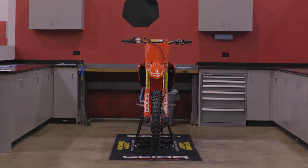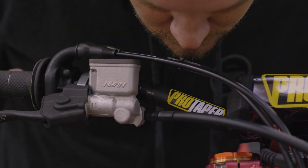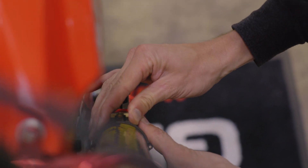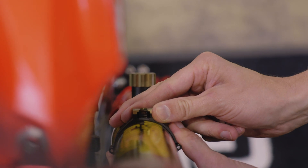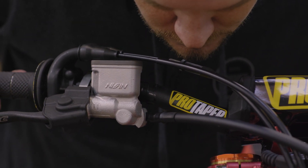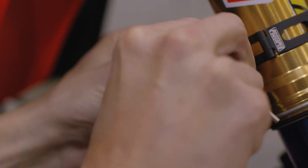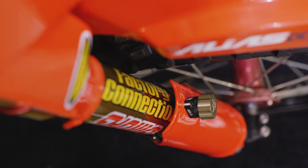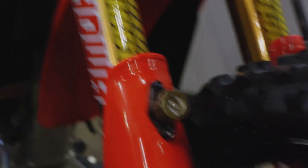The last major step of the installation is lining up the fork ring with the CELA mechanism on the fork guard. Precisely aligning these two components is critical to the safe and reliable function of the system, so we highly recommend taking your time here. In this video, we'll do it by sighting down the fork tube and visually aligning the two components. As you sight down the length of the fork tube, look at the fork ring receiver and the laser-etched line on the CELA housing. Using this line as a point of reference, fine-tune the position of the fork ring until the two components are perfectly aligned. Removing the front number plate can help you gain a clear line of sight down the fork tube. When you've confirmed the alignment, tighten the clamping bolt on the backside of the fork ring using the supplied hex tool — be careful not to move the ring as you do so. Do not exceed the recommended torque specification of 8 Nm. With CELA fully installed, test that it's functioning properly by running it through a few cycles. If you encounter any problems, recheck the alignment of the fork ring and perform the test once again. Now you're ready to be a self-starter.